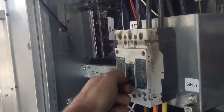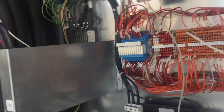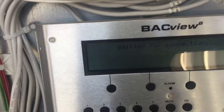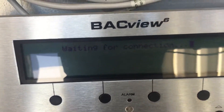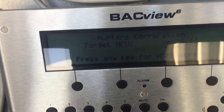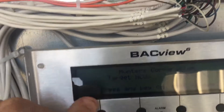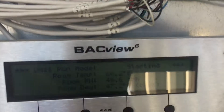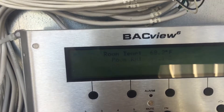Okay guys, I want to show you how to do a quick test on this unit after you've rewired it. Turn the power on — especially if you can't get a hold of F-MOT or you don't need to. You can test these units right here. Press the home button; it says it's starting but we can scroll down using the down arrow.